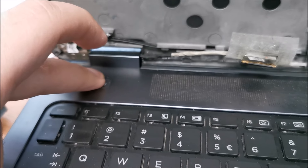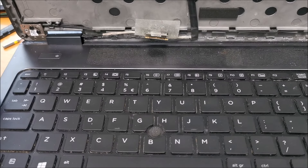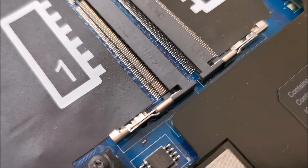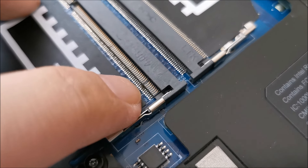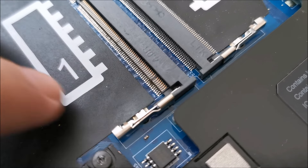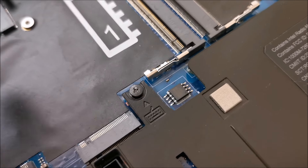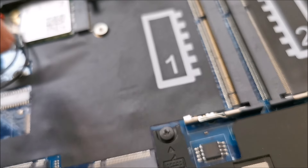This is kind of annoying — the fact that this isn't powering on anymore. I'm going to try and open it further. Maybe it blew a fuse somewhere. But even if I find the blown fuse and it does power on, I have no way of knowing that it can still output an image. I'm starting to see other bad signs inside this laptop. These were not populated and this one is still badly corroded — corroded to the point that it's not even making contact, or maybe even shorting to the ones right next to it. There's a big spot right here.